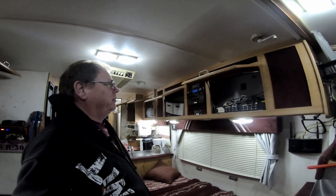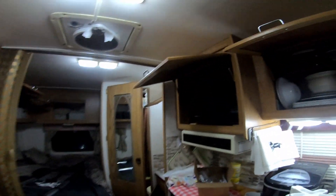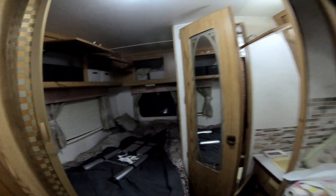One of the last things inside — you'll notice I have all the cabinet doors open. I unplugged the microwave — no sense having that energized. All the cabinets are open, and the door to the bathroom is propped open. That helps air circulation so any moisture isn't going to build up inside a cabinet — it can dissipate. The other thing I like to do is come out here about once a month, check everything, and make sure I don't see any water stains on the roof or traces of water inside so I know I don't have a leak.